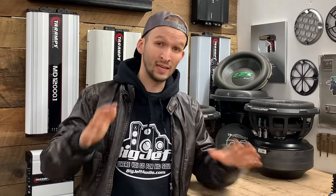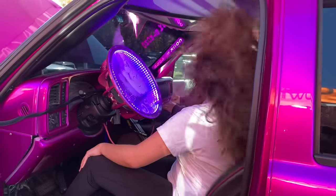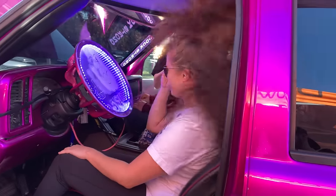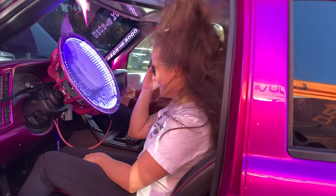Back to the video. Voltage is super, super important when it comes to an upgraded system in your car. This really goes for anything — if you're adding extra lights, extra amps, PA speakers, any of that stuff. You need to have an appropriate electrical system to handle all of it. Most of your 12-volt accessories need close to that 12 volts to even operate correctly. Normally if you drop below 11 to 10 volts, lights, amps, stuff like that will just shut off.